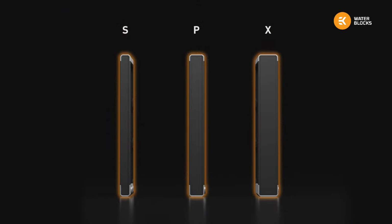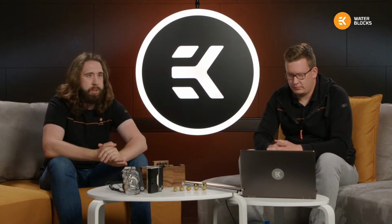So the new S has really been brought up to speed, and we have new internals across all three sizes, but the S gets the biggest change as we tried to increase the core thickness that we have packaged inside the radiator. So the fins are much bigger proportionally to the outer casing, so it's much closer in surface area to the old P. There's a lot more tubes, so it will be less restrictive hydraulically, not just for the airflow, and also a little bit wider, so they're full width, 130 millimeters, just like the bigger P and X.